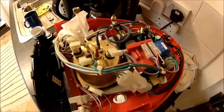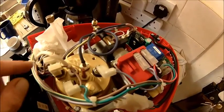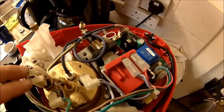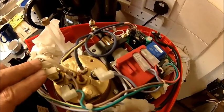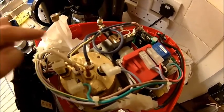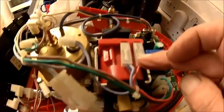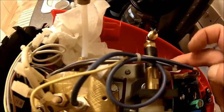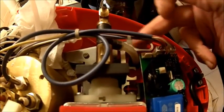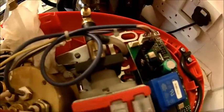So while we're at it, let's talk about the bits here. These two terminals are the heater. I think this is a temperature switch or water level switch — I'm not entirely sure. This is just the temperature gauge here and this is the temperature sensor which goes to the electronics. That's the pump. There is a check valve, non-return valve here and I think there is also a pressure relief valve which goes down to the drain which goes back into the water reservoir. That's the feed pipe which goes into the boiler, and obviously it comes out here. So pretty simple.